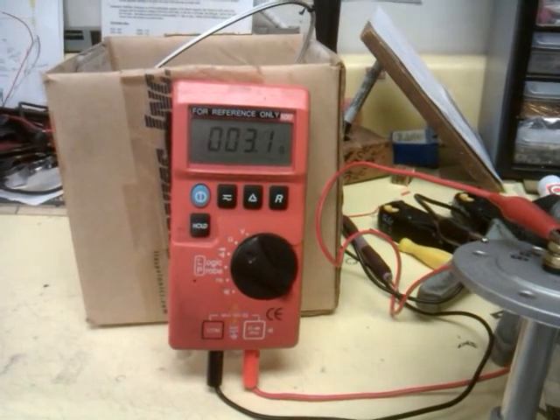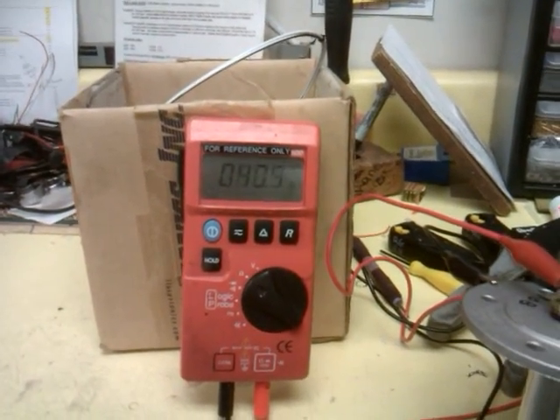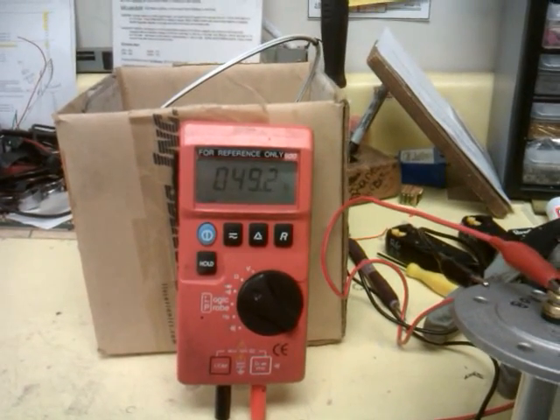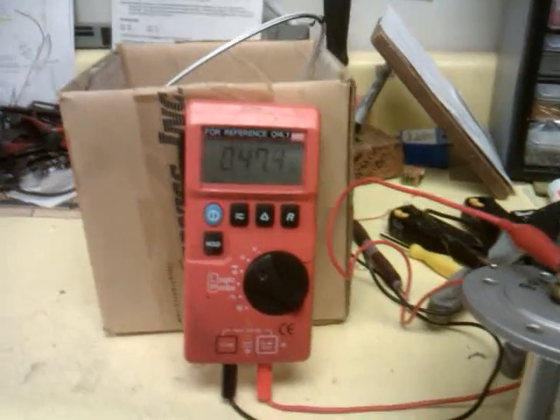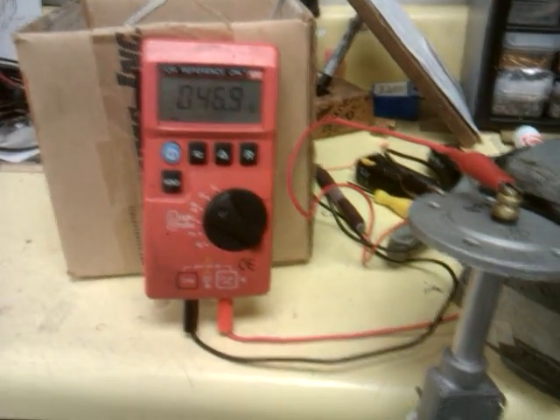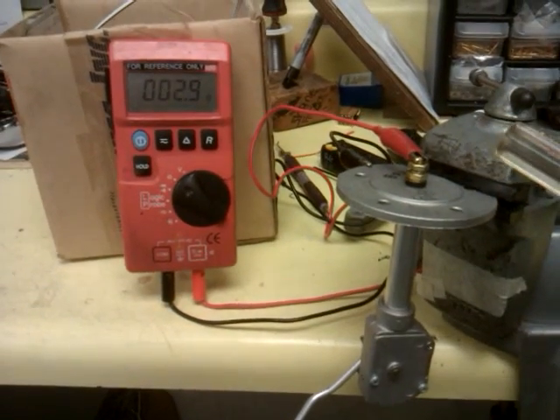It definitely does have issues. From about 40 ohms, it's reading 24 ohms sitting statically — there's 48 ohms, that's out of spec. That'll cause the fuel indication to fail, so this one will have to be replaced.